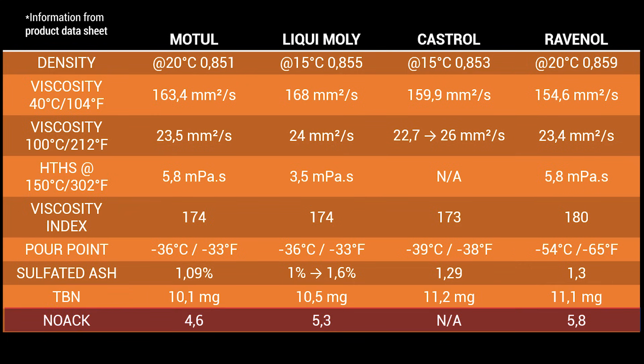And finally the NOAC evaporation index, which determines the evaporation loss of lubricants. In the NOAC test the oil is heated to 250 degrees Celsius for 60 minutes — in my test I only heated to 185 degrees Celsius for 3 hours. Of course, a lower number is better. Based on my testing and the official specifications from each manufacturer, I believe both Motul and Ravenol are the winners. They both have great results and the difference between them is marginal. Liqui-Moly is a little behind, and Castrol is still making shampoo. But we all know that in motorsport, the best oil is the sponsored oil.